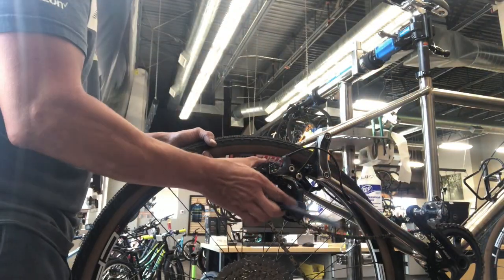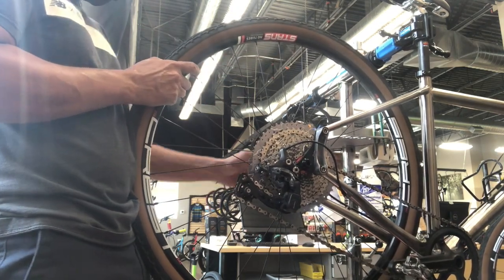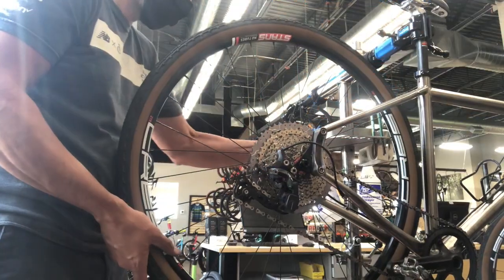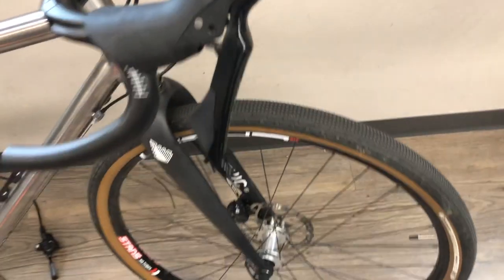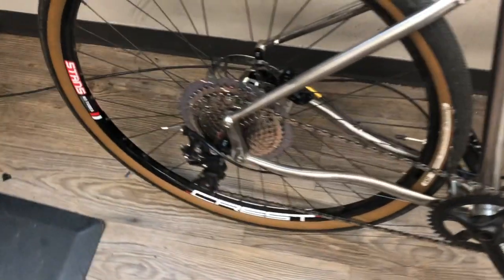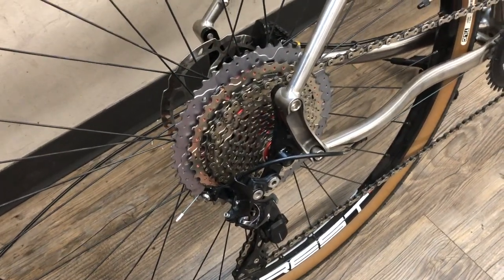Put the brake pads back in and ready to put the wheel in. For the front brake it was just a matter of cutting the hose, sticking it in — it had fluid already in the hose and we used the flat mount brake caliper that came with the shifter, so we didn't even have to bleed it. That's the beauty of those with the yellow plug on the master cylinder — you just cut the hose, put your barb in, stick it in, and you're good to go. Went out, test rode it, and everything was functioning correctly. The customer was going to finish up the tape. Hopefully you found the video interesting — I'm going to try to do the SRAM version soon. Thanks for watching, see you guys next time.